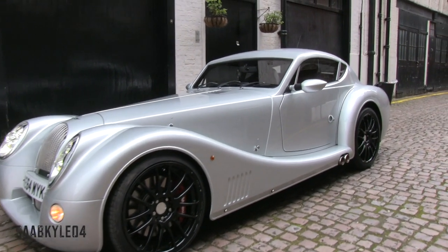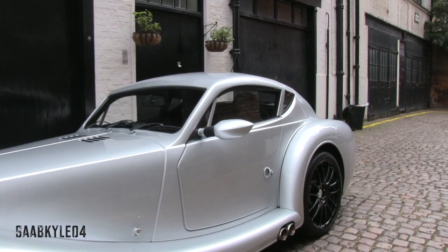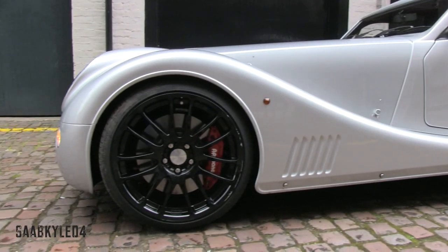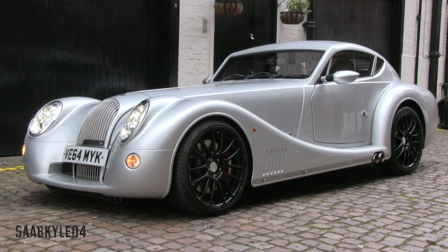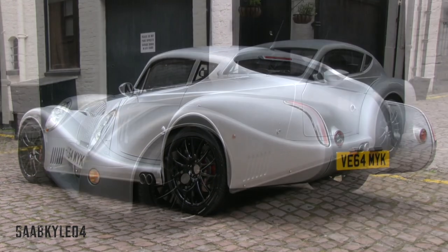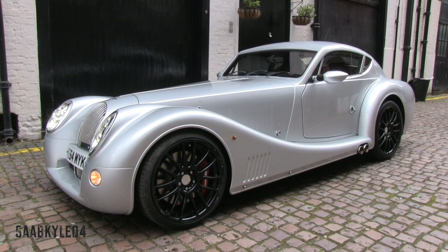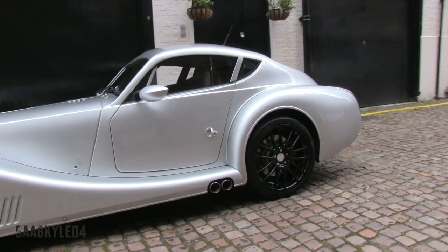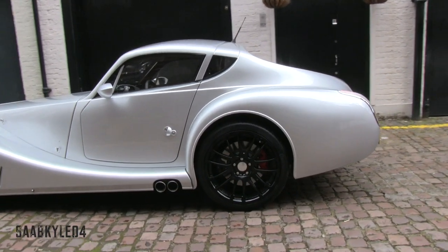Where the Aero made great strides is an all-new rigid aluminum chassis weighing about a third that of steel. The chassis is bonded with aircraft-grade adhesive and secured with rivets, quite a difference from the wooden tub and steel chassis of traditional Morgans. The Aero's chassis is made from 32 individual parts that for the most part are bent and formed by hand, a process that takes about 4 hours per chassis.